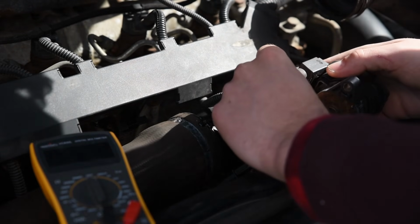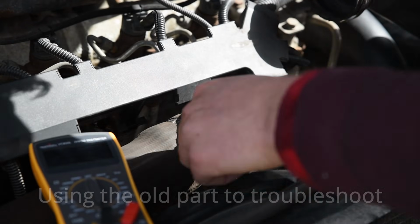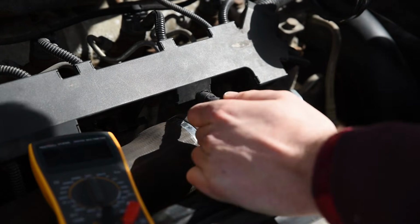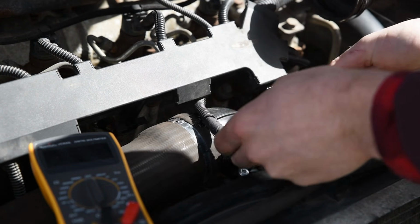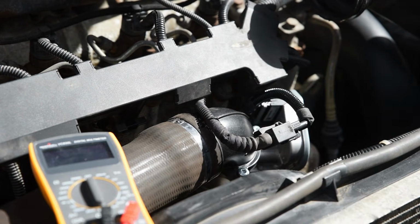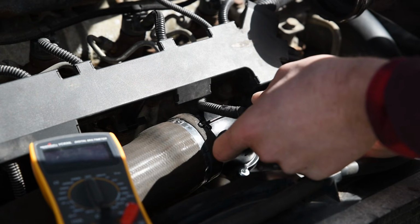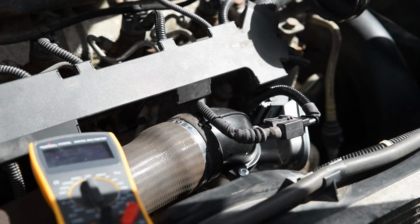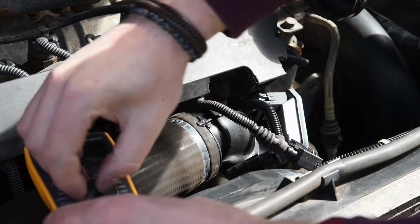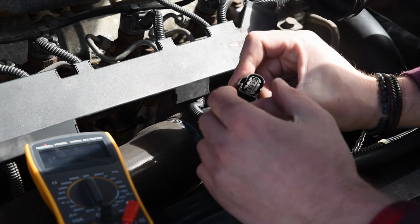So we're not yet at the end of our troubles because there is a fault in the connector. I can now hear the valve clicking with the adapter cable in between. I guess you can hear it clicking. So we have a bad connection. Everything looks very clean, the connections here on the other side.